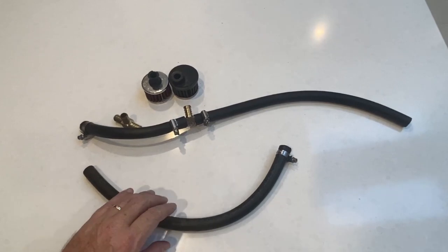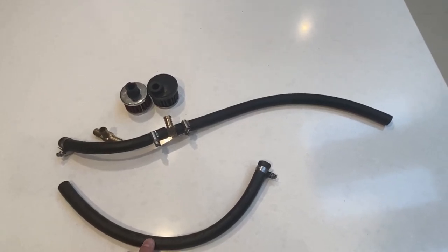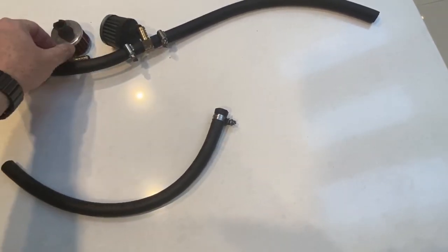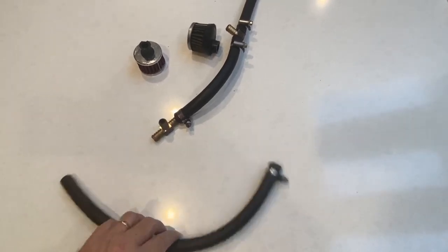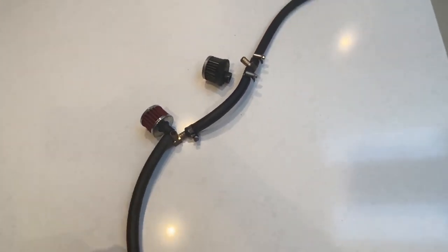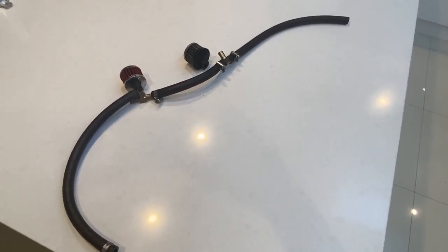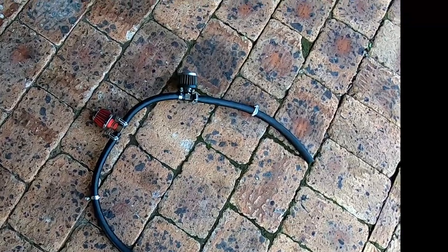So these are some of the things I'm going to use. I'm going to vent the two tappet covers, and to do that I'm going to run a hose from the one tappet and then use these vents. I'm going to use that T-piece, and the other hose will come around to the other side, and then the two vents will connect like that. That should give me a venting system to relieve the crankcase pressure from the tappet cover. This is the vent pipe from the one tappet cover around to the other, just for those air vents.